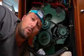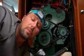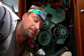So let's go to the back where we check the oil and the tension of the impeller belt and the coolant. Oil level is between minimal and maximum. So I like to add a bit more oil just to be sure. Our engine is used to using a bit of oil. We know that, and I think the valve guides are a bit worn, or maybe it's another problem.